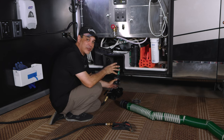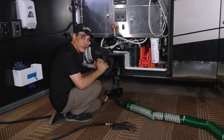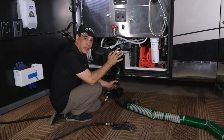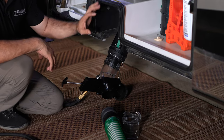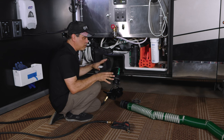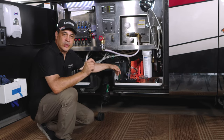A quick tip I do because I like to be thorough: I do the jet wash first, then come back and do the hose wash again, then do the tank sensor cleaning overnight, and flush it the next day. That's the ultimate — you can't get any better. If the tank's dirty with black stuff inside, your sensor cleaner is doing a lot more work. Get the tank clean first, then the sensor cleaner can do a much better job. One caveat: you can't do some of these processes with a macerator system. You're not going to be able to get a hose up through it — you'd have to take the macerator off and put adapters on. So the ultimate process is: power washer with adapter, come back with hose and Flush King, then do your sensor cleaner.